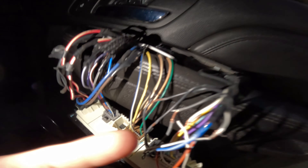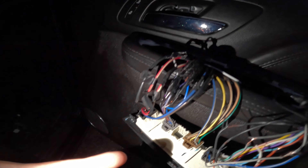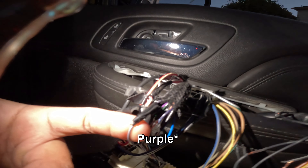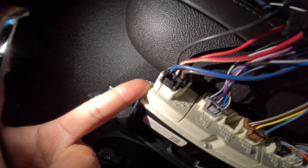It's getting late because I ran into a problem — my mirrors weren't lighting up so I had to redo everything. This is the turn signal — I got the indicator all spliced together. Over here the day running lights are connected to this one. The white wire was connected with a light blue wire, and the negative or ground — there are three cables total: the ground, the day running lights, and the turn signal. I connected the ground to the main harness — it's the biggest one and the most noticeable. Once I did that everything started working normally.